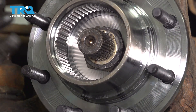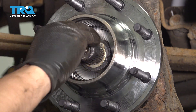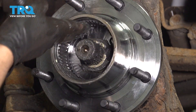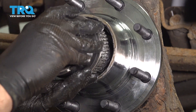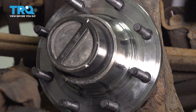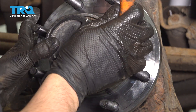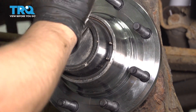Everything spins very freely, so that's good. I'm going to add some grease to all of these splines as well as the axle — this is where the hub is going to go on and lock in when you're in four-wheel drive, so it's important that everything is lubricated properly here. You don't need a lot of grease, but you need some in all of these splines. Take the locking hub, line it up with the splines, and push it in. Wipe off any excess grease and reinstall the ring that locks it in. Push this all the way in to make sure that the locking ring can seat.